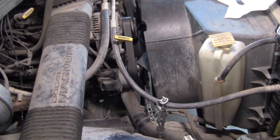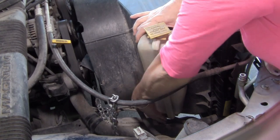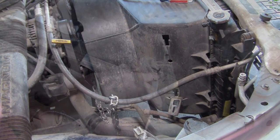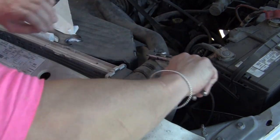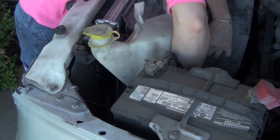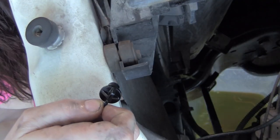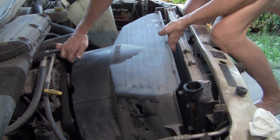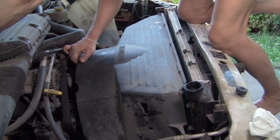This was like the easy part really. You get the fan off first, then you take the little shielding part off. You first take the excess water spillover reservoir off — that's easy. Then it's the washer fluid thing — that's pretty easy. Then it's the hose — that's easy, easy to get to the clamp. I drained it at this point; there's a plug at the bottom, that part's easy. Antifreeze is poison, so make sure there are no animals around to drink this stuff because I spilled it all over the place, but I did keep most of it. Then once you unbolt the shielding part, make sure the fan doesn't hit the radiator. You can wiggle this big giant thing out and pull it out, and now you have room to get into everything.